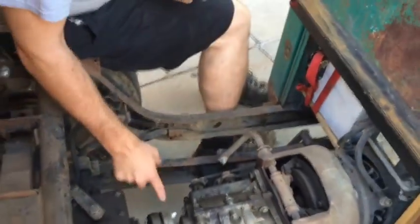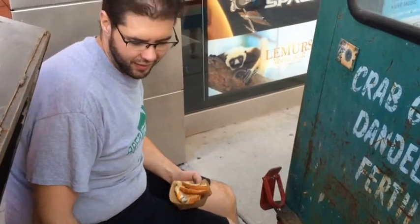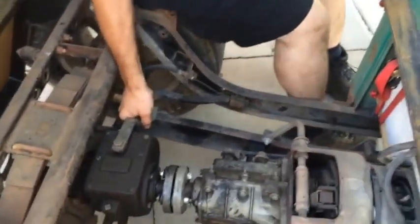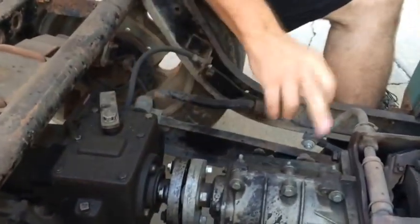The original shaft was completely eliminated — each of these plates originally coupled to a shaft about that long, and now we just went straight through-bolt. The challenge now is gearing: this is a high-low box, so I flip it forward and back for high and low, plus a three-speed. In third-high this thing tops out at about 20 miles an hour going downhill, but I'm able to pull a '73 Chevy C10 — done it twice with video evidence.